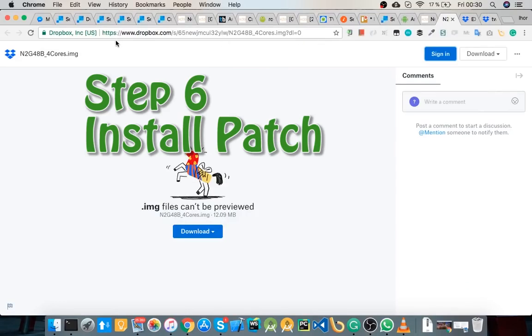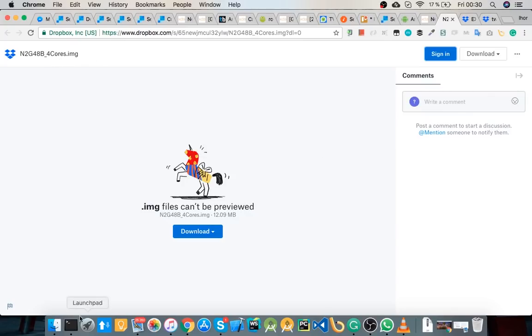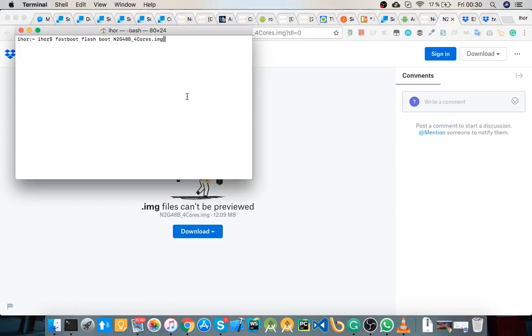Open this link, which you can find in the description, download the file, navigate to the downloaded directory, reboot your phone to the bootloader again, connect it to your computer, and from a terminal run fastboot flash boot n2g48b.img file to install this patch, which disables 4 cores. After it's installed, you're not gonna have bootloop anymore, but your phone is gonna be super slow.